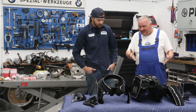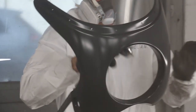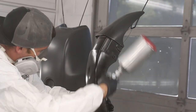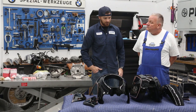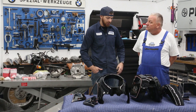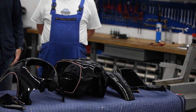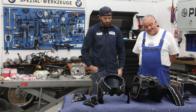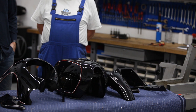Tell us a little about the paints and processes used. All Glasurit, from start to finish — we stripped the parts down to bare metal and raw fiberglass, reprimed everything, brought it back up, did all the body work, blocked everything out. Used the correct Glasurit black, then the striping on top of the clear. You were real specific about the stripes, so that helped us do our job the right way. The stripes are just typical One Shot, nothing special, and we polished them out just like every other job. Glasurit from the ground up — primer, base, and clear.